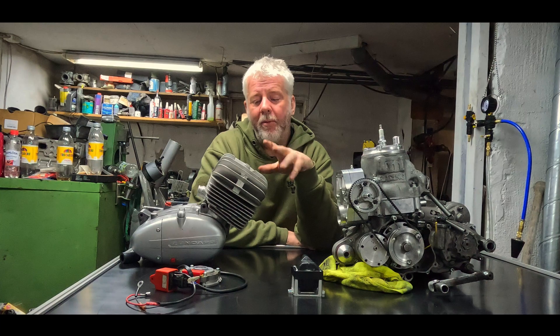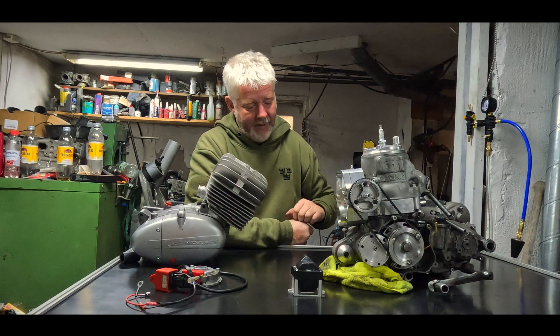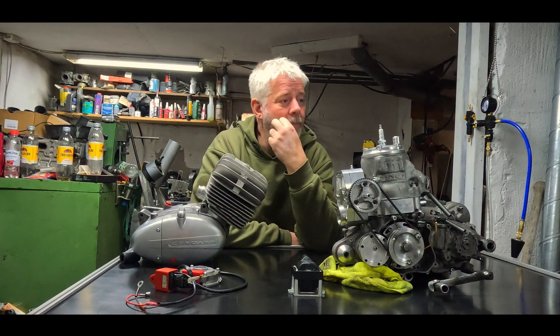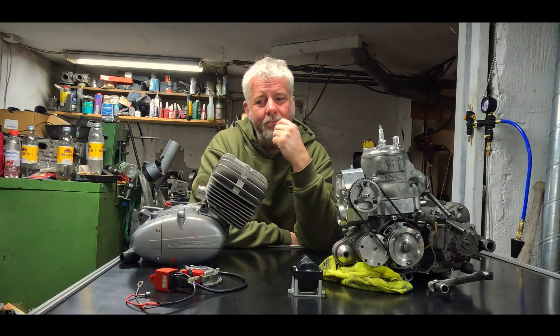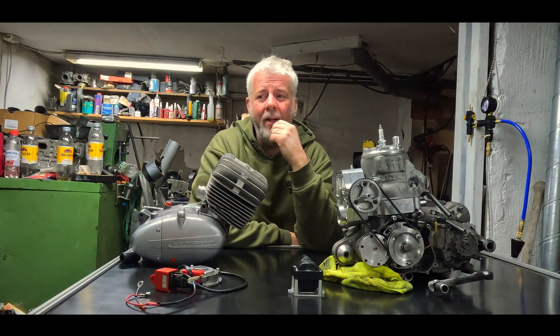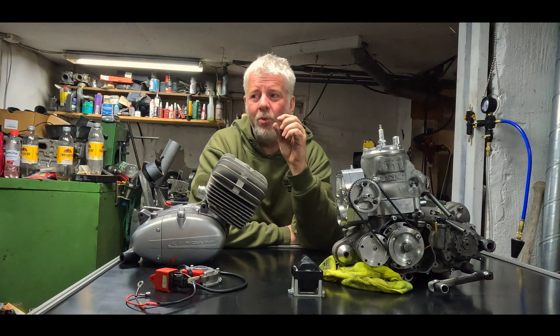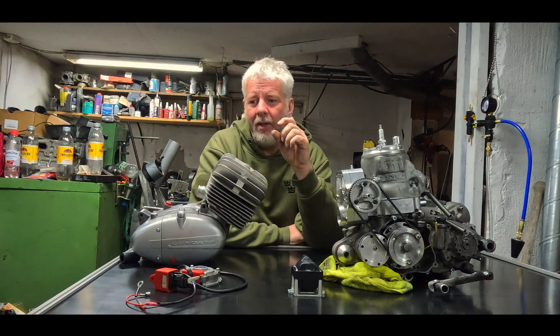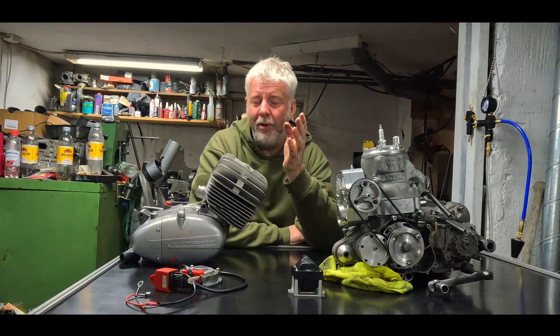Back from that, the result was alarmingly good actually. I made the first two rods equal to rods I had that I didn't use. Then I made a couple of rods equal on idle to rods that were working on idle but were way too rich on top. Then I made a curve on the rods and first try — success, actually really good.